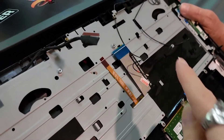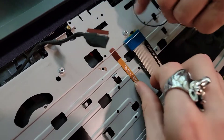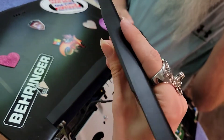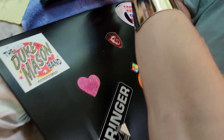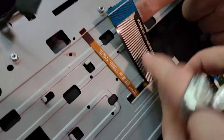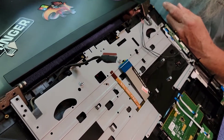We made an error: if you do not pull the ribbon cables from the keyboard out first, you will screw them down and won't be able to get to them until you take the hinge loose again, which you can't do until you take this off and pry the little tabs off — and it takes forever. So make sure you always pull the ribbon cables out first through this slot in the steel plate before you start assembling.